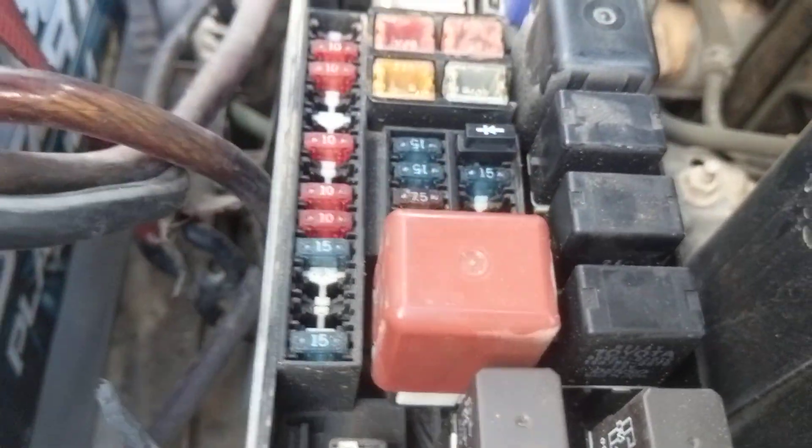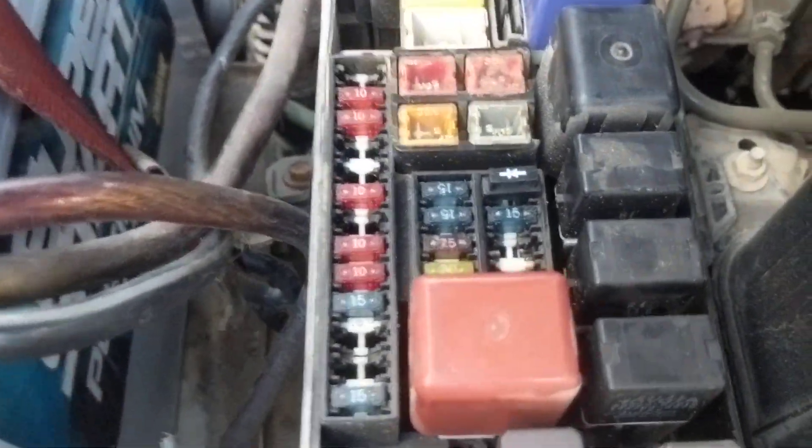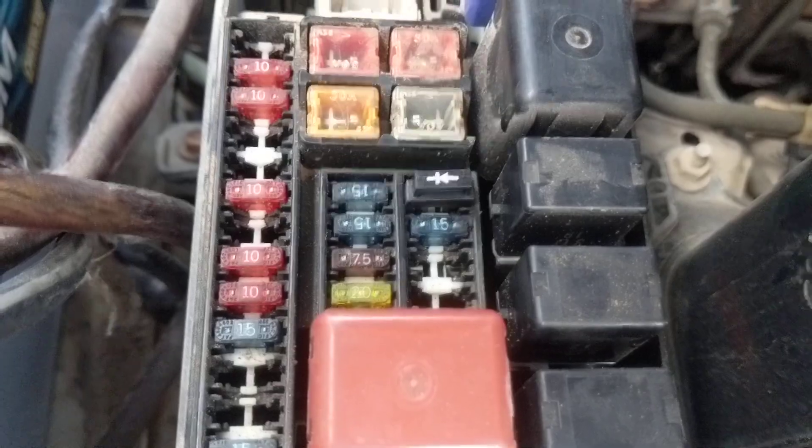This diode does have a small key on the side of it, and the fuse box of the GM is keyed, so on the right side of the little nub you have to kind of cut it off — a knife or paracord snips works great. Drop that in where your alt-S wire hits the fuse and goes back out. Fire it up and see what happens.